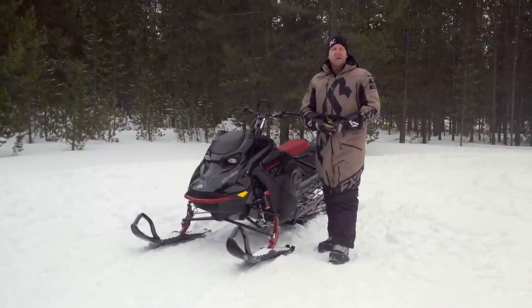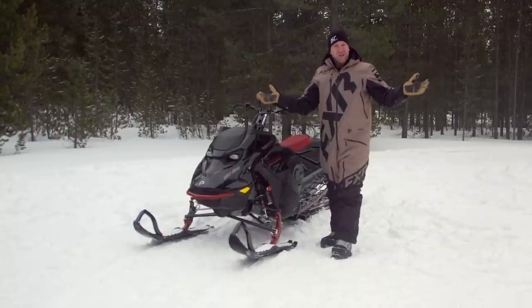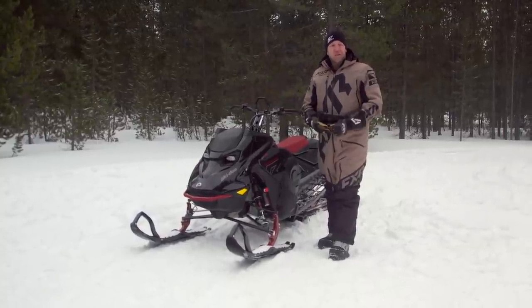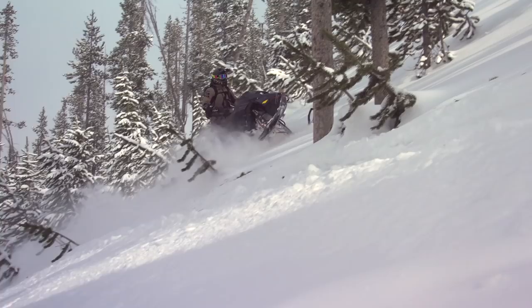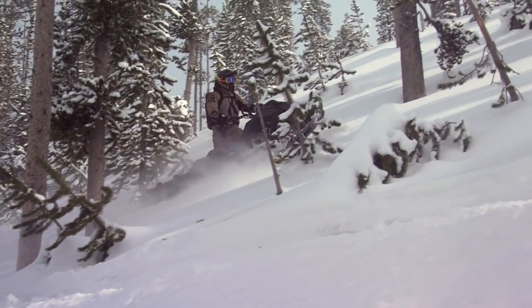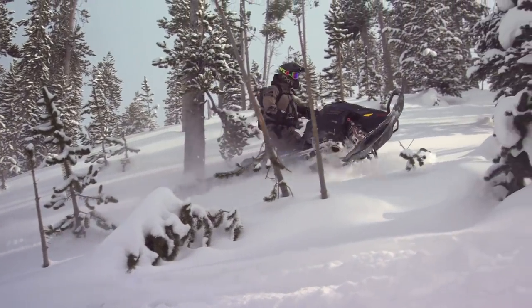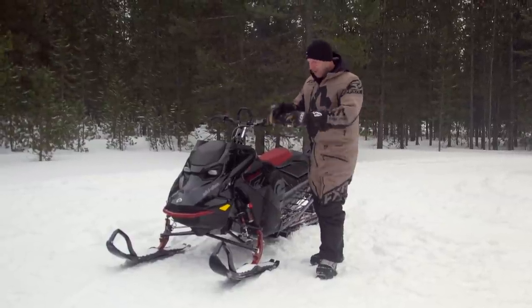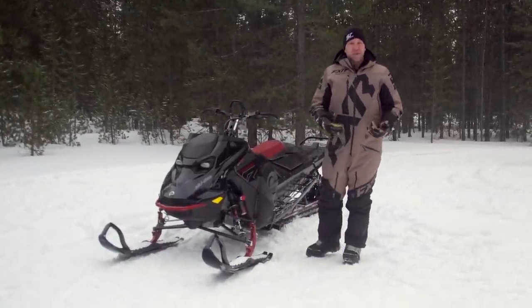When it comes to the KYB shocks, they are adjusting low and high speed during that wide ratio at the same time. So say you've got 22 clicks of adjustment on a typical KYB shock. Now they've turned that into three. Low is over here on the low end, medium's in the middle, and high and firm is on the far right hand side, which is for those big drops, big jumps, all that fun you're doing. They put those three position clicker shocks out back as well, so it's really easy to adjust now.